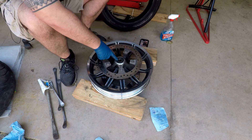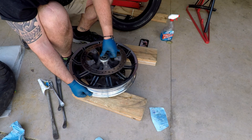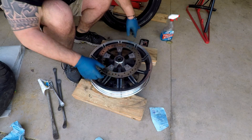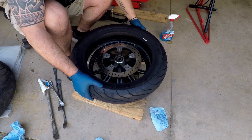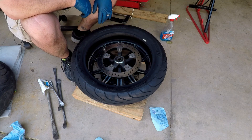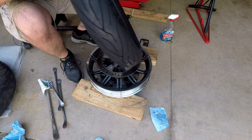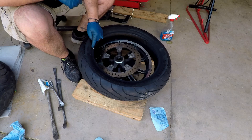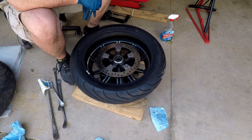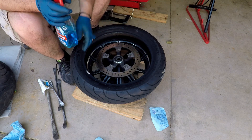Just to verify: there is one bearing that should be yellow — and it is yellow — because that is the ABS bearing. So that side is on the left, this is on the right, wheel turns this way. The tire says 'front' right here with a direction arrow — wheel and tire turn this way. My valve stem is right here. I don't see any dot on this tire like you'd see on a car tire, so I'll just line the barcode up with the valve stem. We're going to balance this with Dyna Balance beads.